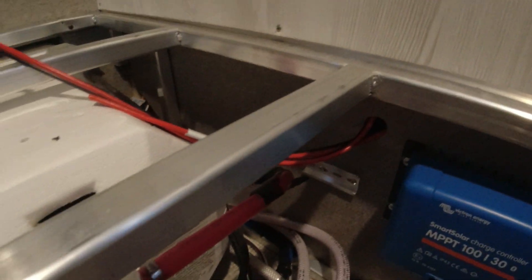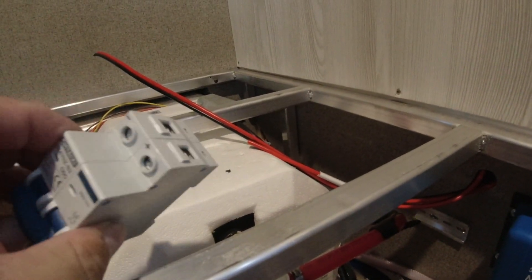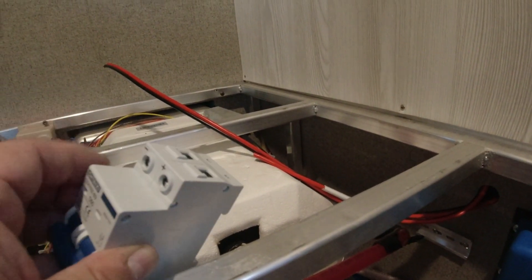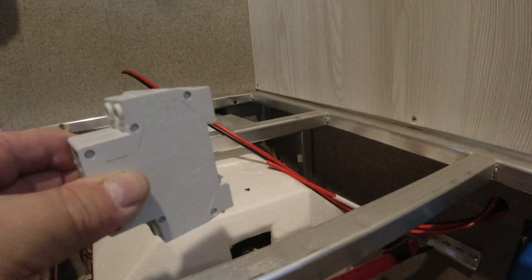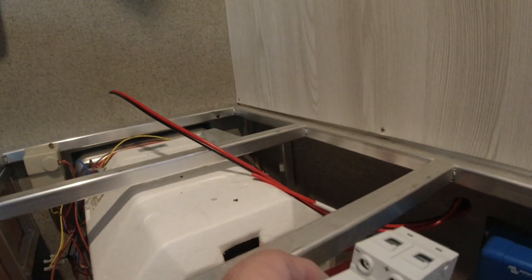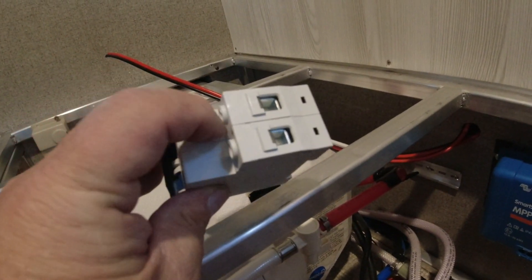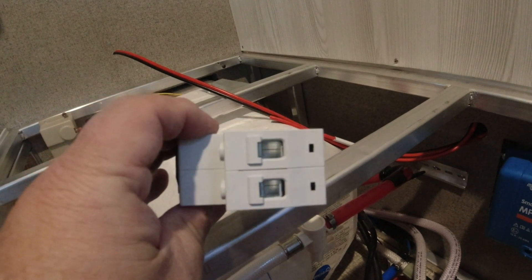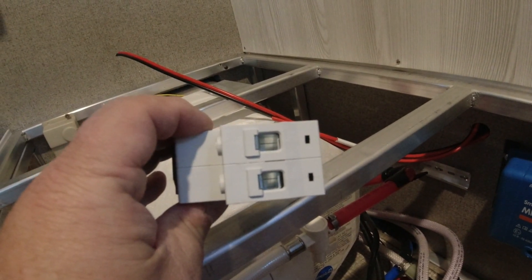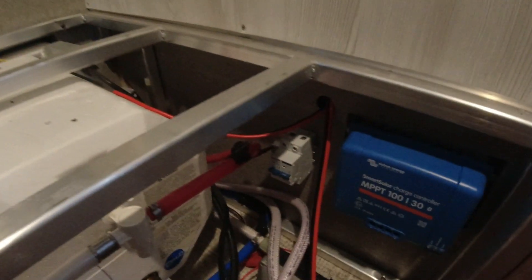We're putting that little rail on — that's what the breaker hooks onto. If you don't have this covered with something you should have a special box, since these fit in one if someone could put their fingers in it. But this is going to be down underneath so I'm not worried about it. When you get ready to put this on, make sure you back out all your screws so that metal plate is in the very back — that way you have a full place to put your cables in.